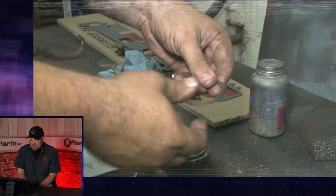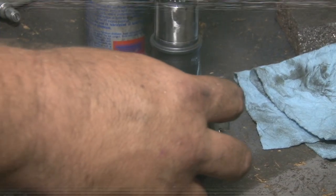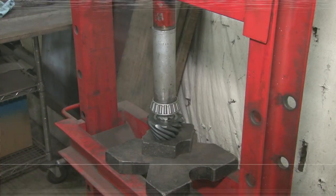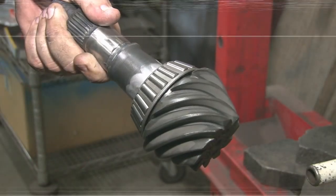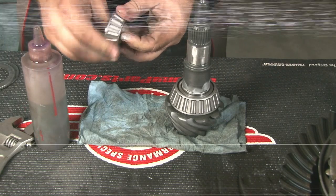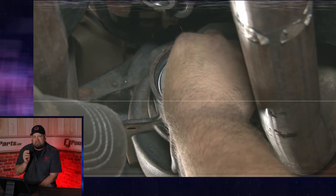Now we can remove the shim off the old pinion. This is definitely a time-consuming job — you're going to spend a lot of time cleaning things and measuring things, and this is a job you want to take your time on for sure. Then install the new bearing, put the original shim in place. Now that our pinion bearing is pressed on, we can install the pinion back in our housing. Before we install the pinion, we'll put a little grease in the bearings. The most difficult part of this is just all the little pieces and making sure everything is shimmed right, you use the proper shims, and you measure properly.